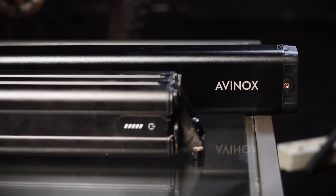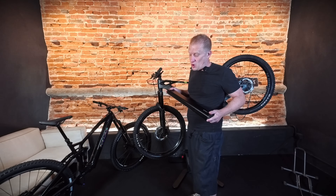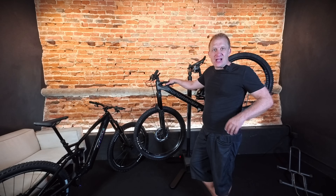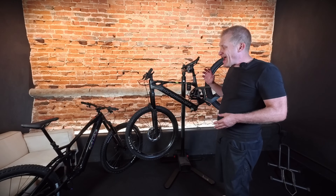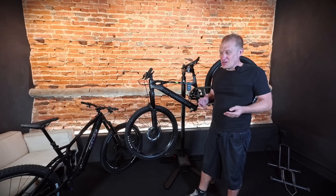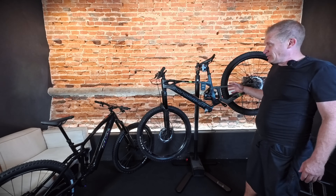The total weight of the T-Wing comes in at about 21.5 kilos. The Avinox battery is 200 grams lighter than the Bosch 800Wh but 700 grams heavier than the Bosch 600Wh. You can use a thousand watts because the motor peaks at 1,000 watts, which means you'll drain the battery more quickly. This whole idea of 'full power, lightweight' really comes down to one thing: it's all about how light you build the entire bike. It's absolutely nothing to do with just the motor and battery — and I think that's where the marketing has got it wrong.